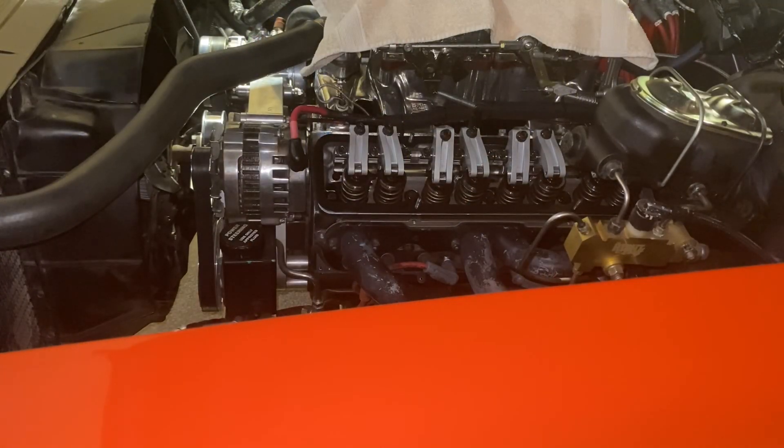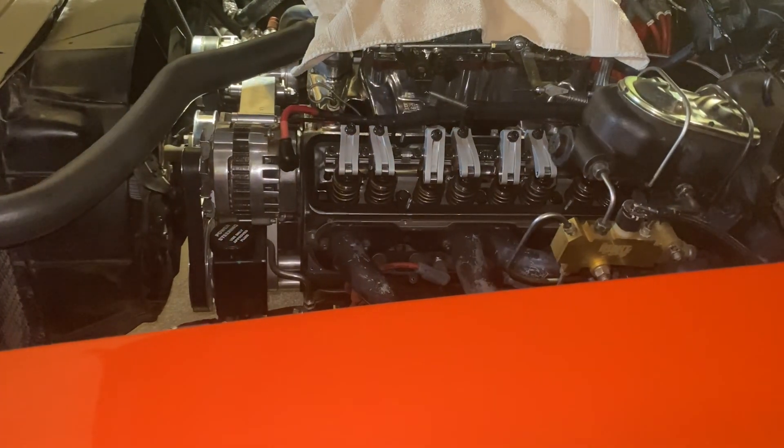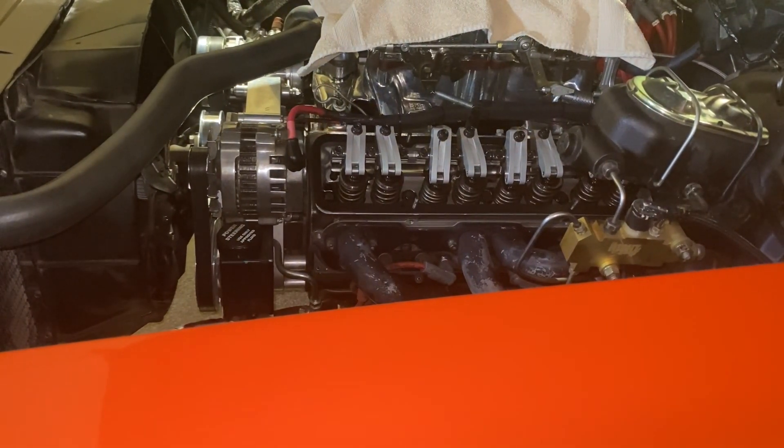All right, finally got my rocker arms mounted on my small block Chevy here. I pulled all the spark plugs out so the engine would turn over easily, then I put the stand on there, tightened it down to 35 pounds, then I put one set of rockers on, spun the engine over, and found out that I had to come up with that stand. So I put 150 thousandths underneath it, and that brought it out to be dead center on my valve — I like that pretty well.